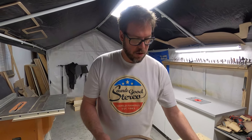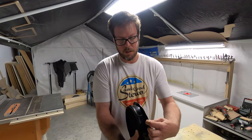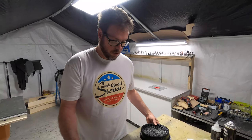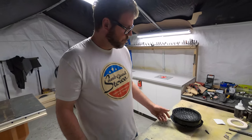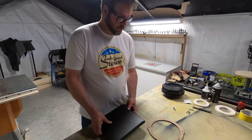So the factory hardware is a larger head and it's too short because it was designed to go through this really thin plastic, like 3/16 inch thick. We're going to be going through at least an inch of plastic, maybe 7/8 inch. Plus ours is going to have a lot more power handling, a lot more movement. That's where the stability of our different materials comes into play.